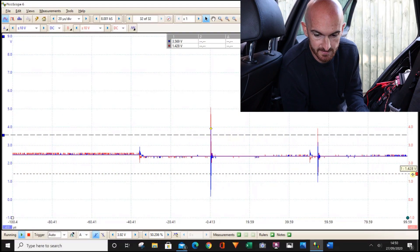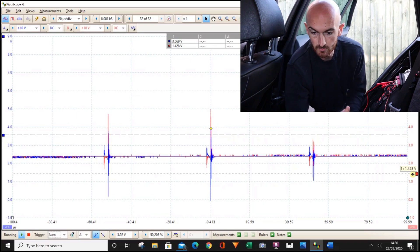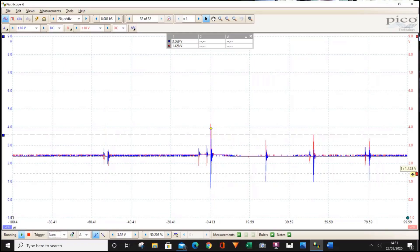We're going to look at how much resistance it can take when shorting the lines together. A dead short looks like this — we'll also get the warning on the dash. So when we're dialing down the resistances, that's what we're looking for: the point where the network can't take any more. The wipers start going as well.